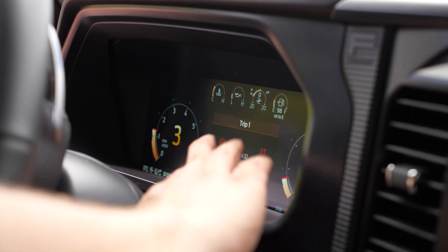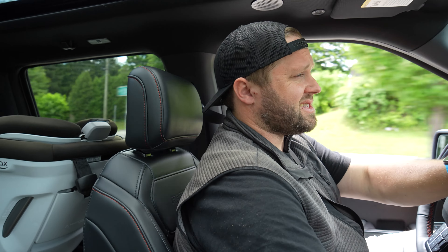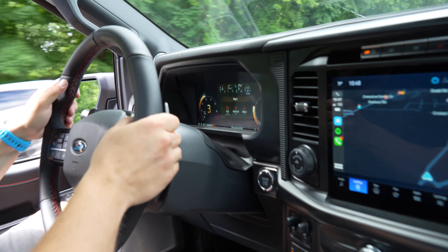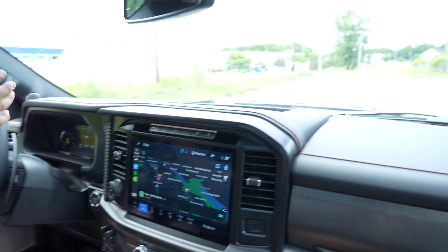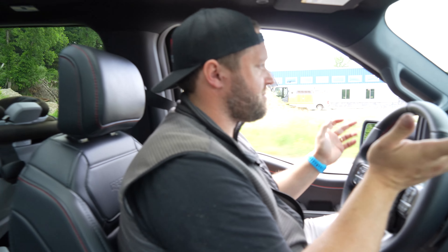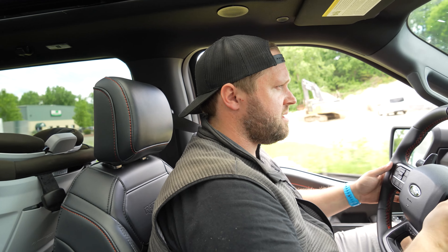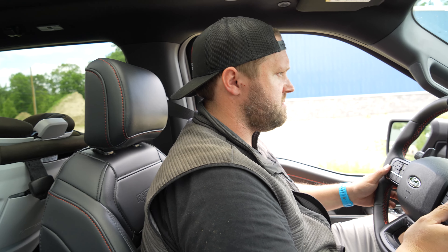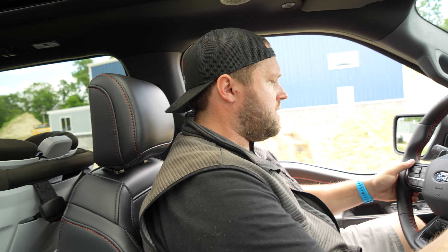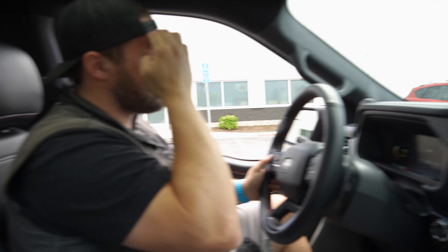All right, we're hearing it. Keep an eye on the boost gauge there — it's the factory boost gauge, but it kind of gives us an idea if something's way wrong. It doesn't sound or feel wrong. Sounds good. 17 or 18 psi I think is probably right, and it goes fine. It was louder on the 24 actually. Sounds great.